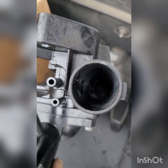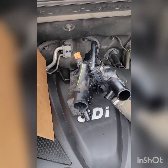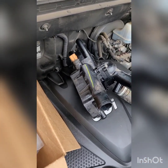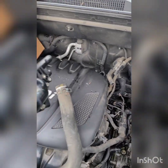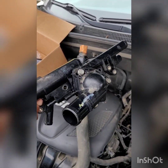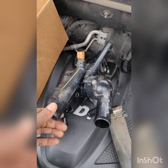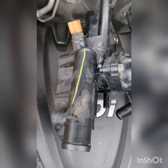You can see it on the inside too. We thought it was a heater hose at first, then she called me back - hey Derrick, it's still doing the same thing. So I said, let's just replace the housing because it's plastic. The dealer cut costs - plastic is cheaper than aluminum. I don't believe they offer an all-aluminum thermostat housing for these years, but they'd sell a bunch if they did. That's the crack right there.